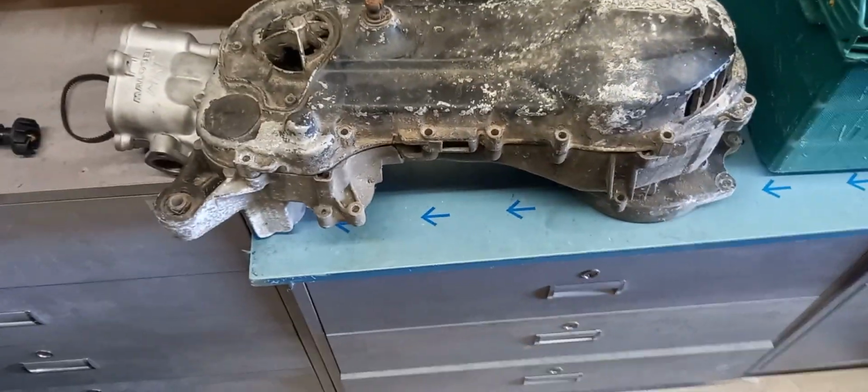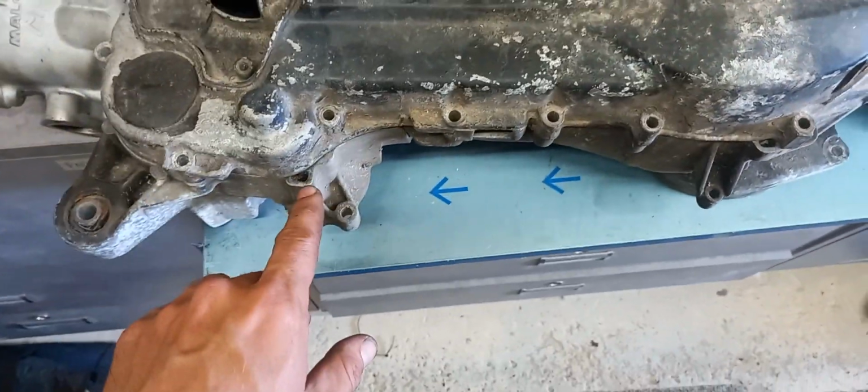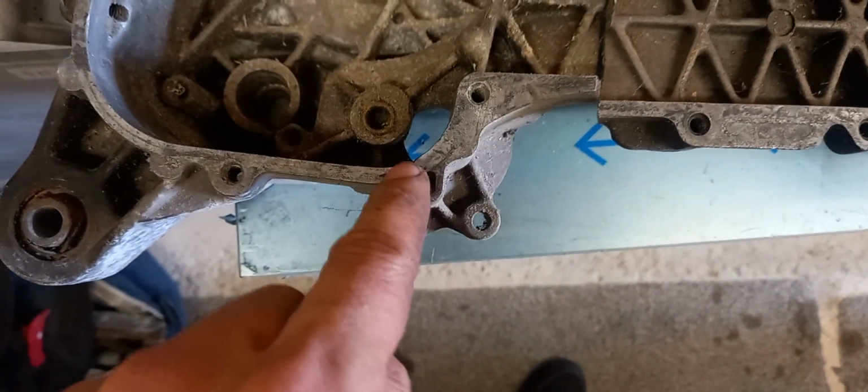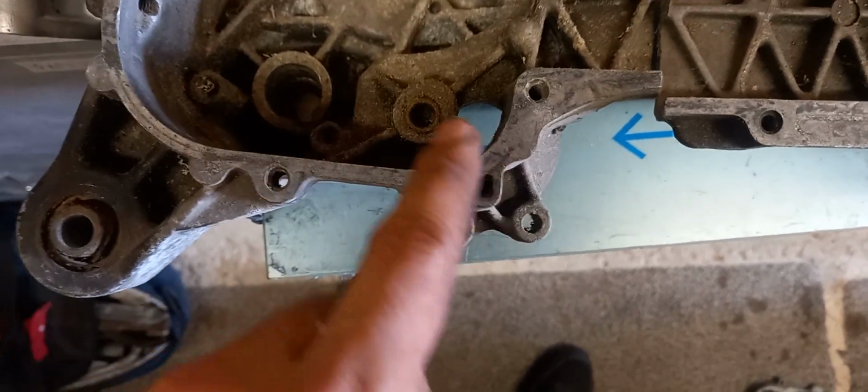Alright, so I'll show you where that goes. Obviously when the water pump seal goes, just behind the seal is bearings, so that's when it gets a bit messy, you could seize it up. So this is a Piaggio Gilera case. There's that little hole. See where it goes, just up through there. So when the case is on, there's a little passage for water to come out.